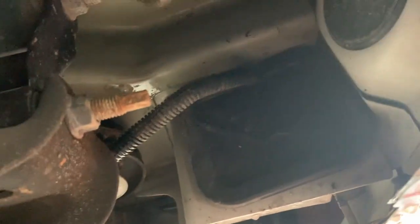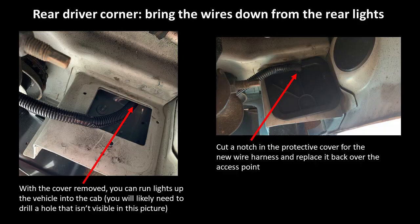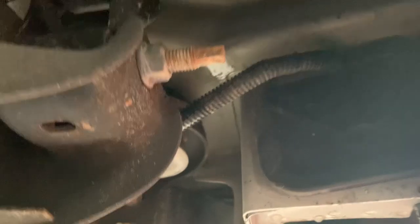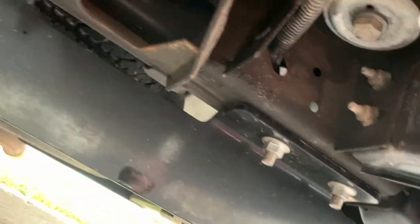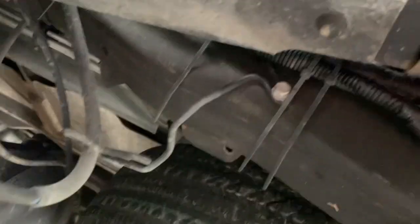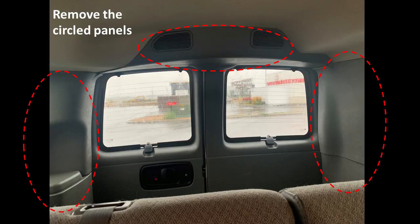There's this little cap here. The cap's pretty easy to pull off. You can see a picture here with the cap pulled off on the left. The wire goes into the lights up there. Just drill a hole through a plastic guard, and then you could notch out the cap and put it back in. Then the wiring harness moves forward along the frame — you can see I've got it zip tied to the frame and keep running it up to the front of the vehicle.